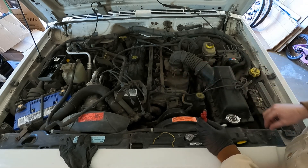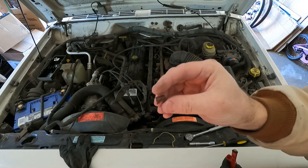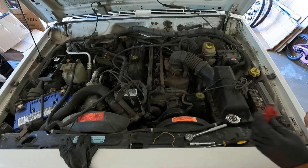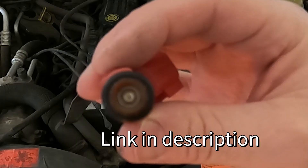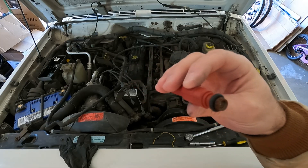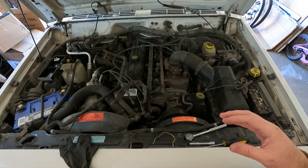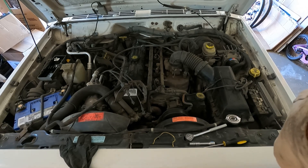These injector plugs are really brittle, so I might have to replace them. I've already broken a few clips on them. I'm not sure how I'm going to hold this front one on anymore. Basically what I'm doing is replacing these injectors. There are actually 12 holes in this injector, and the one that's in the Jeep right now only has one hole. The 12 holes make it atomize really well, spread out the fuel — a really good mist that it can burn quickly and efficiently.